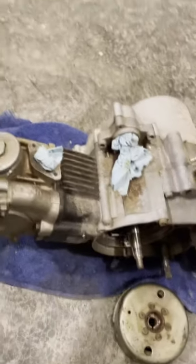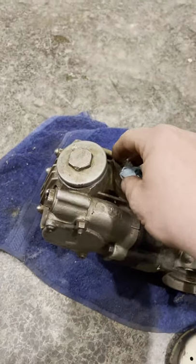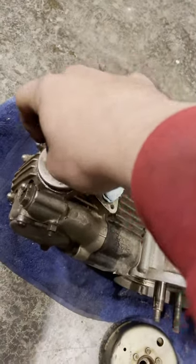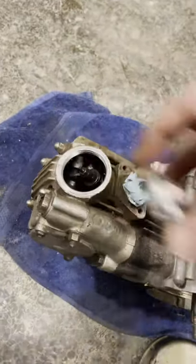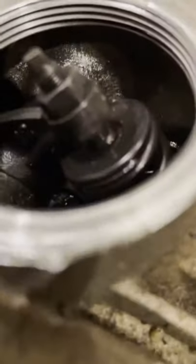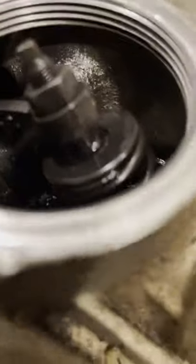Of course with the engine in the chassis, you're gonna need to remove your carb intake that goes here. A 24 millimeter is your valve cover — yours is probably gonna be a lot harder to take off than that. You're gonna remove that and expose your rocker arm and your valve spring.